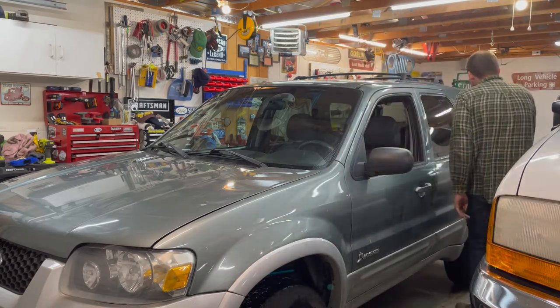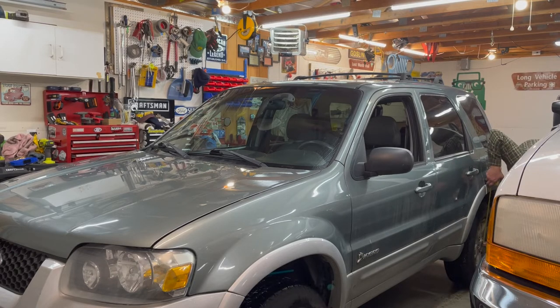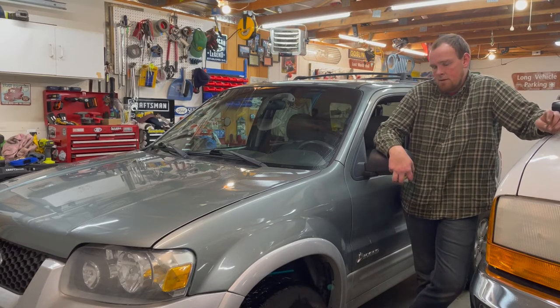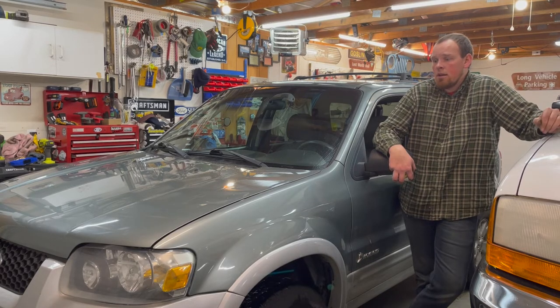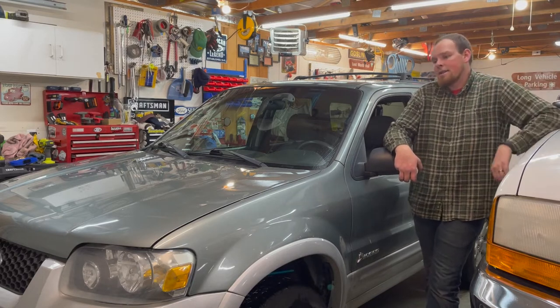Let's look at the back, because I'm trying to figure out if it needs the back up higher or if the front is okay. Center of the hub to the bottom of the fender in the rear is 18 and a half. So we're about 3/4 inches low, which is the amount of JL spacer that I got. I might pull the rear tire off this thing and measure the spring and see if my JL spacer doesn't work. See if I get this thing sitting really level.